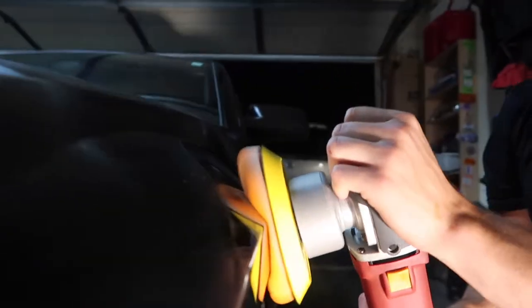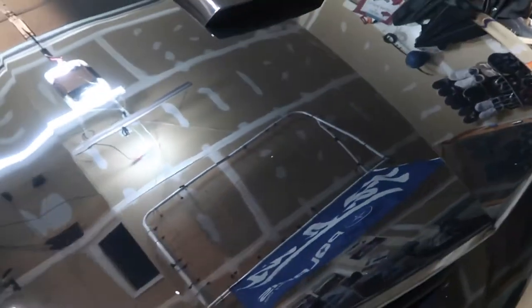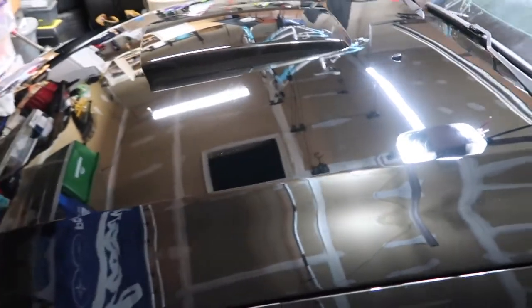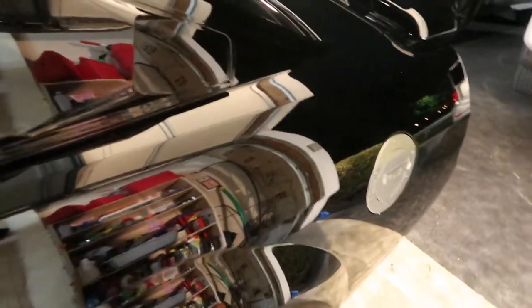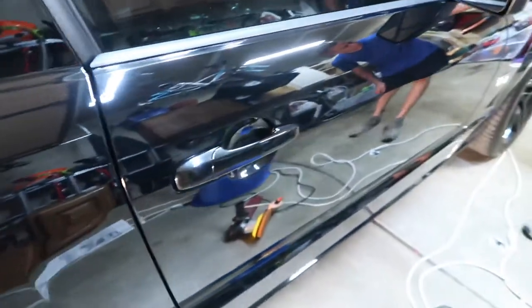So a little status update right now. We have gotten almost all the car done besides half of this door and this quarter panel right here. As you guys can see, the correcting polish has done an amazing job getting all the swirl marks out, or almost all of them. Obviously, this is an 11-year-old car, so you're not going to get everything out, but it's got the majority of the swirl marks out. We've been using just correcting polish on the car for almost two and a half hours now. So it takes a while - this is not a fast process, this is not something you want to speed through. You want to go slow, make sure you get everything done right, otherwise you're going to have bad results.